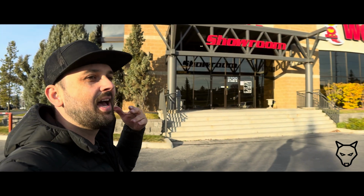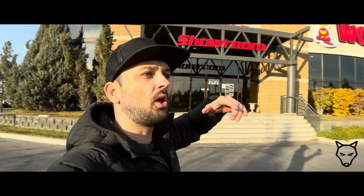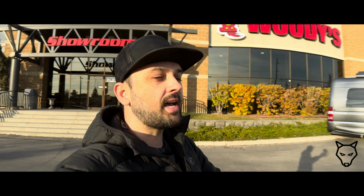The issue I've realized with my testing method is that it only measures static suspension travel. It's not actually measuring dynamic suspension travel. By just bringing it up on the blocks, it's perhaps not bringing the suspension into full compression. It's just reflecting the current weight of the trailer. So I still think it's a useful test. However, bear that in mind.